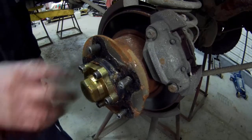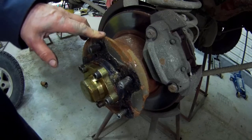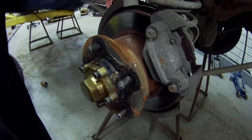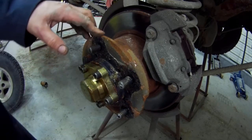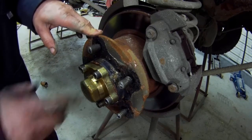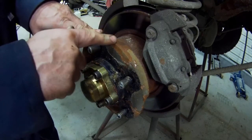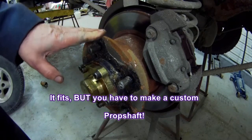A couple of years ago, I used to use my 110 here as an experimental vehicle for trying things out because it had drum brakes on the back and I was never too happy with them because they were always adjusted and the pedal was on the floor. That was never really good, so I wanted disc brakes in the back, and the only way I could fit them was to put the actual Discovery 1 rear disc brake axle in the back of the 110.